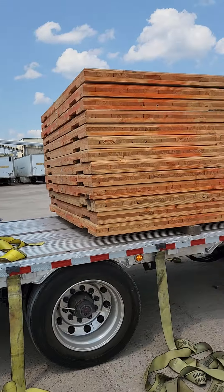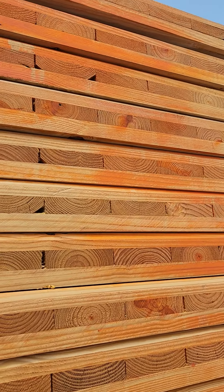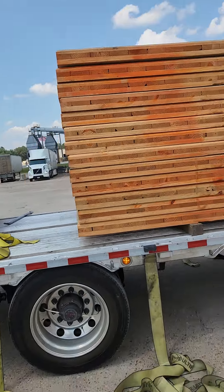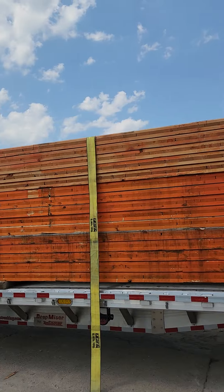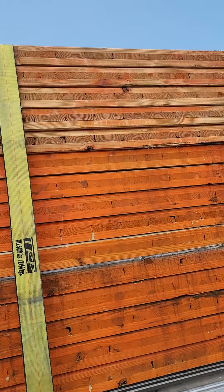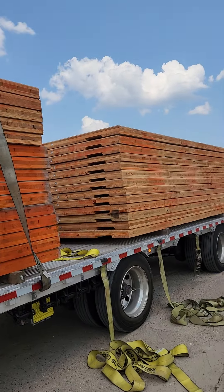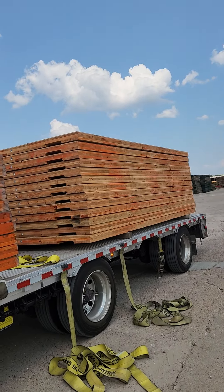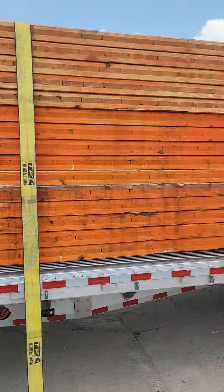Alright, so what's that — 16 plus 13 — running total: 17, 18, 19, 20, 21, 22, 23, 24, 25, 26, 27, 28, 29. So I got 29,000 on my trailer axles. This is supposed to be centered more in the middle so it can evenly distribute weight toward the front and the rear, not putting all of it on the trailer axles. But I know for a fact this will be situated within that 40,000-pound trailer axle weight limitation the way I just got it moved.